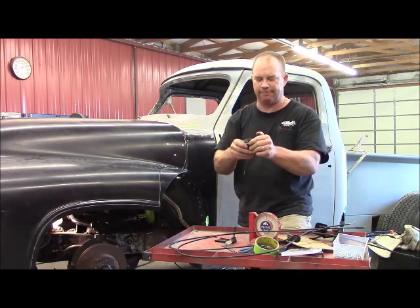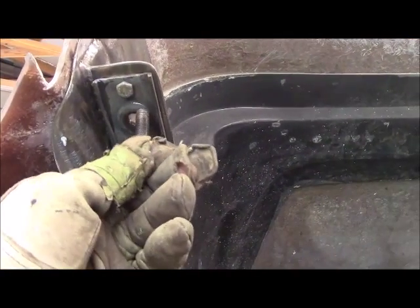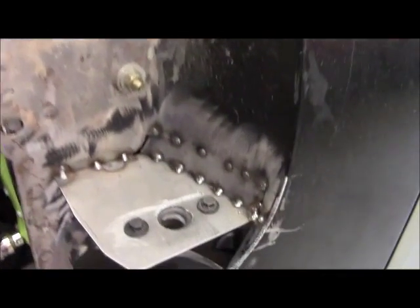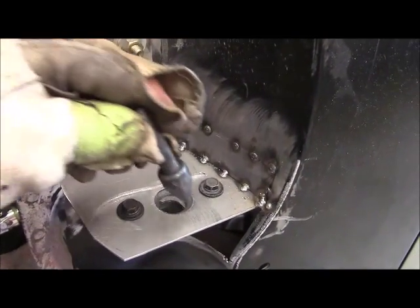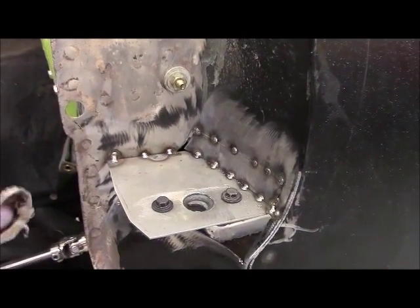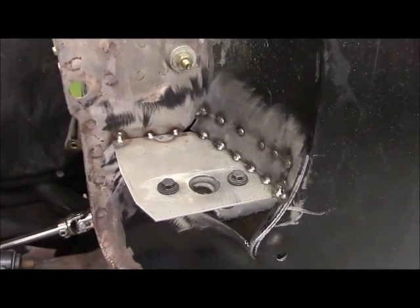Let me show you what this looks like inside. Up here on my hood, I've made a little piece of angle plate and a piece of 16-gauge that I've formed to the fiberglass hood. My pin will go in there and I'll have the spring on it like your regular hood latch. Down here on the firewall, I took the strike off the Chevrolet car and mounted it up in here where it'll move around and be adjustable. My pin will come right down and strike right into it like that. Then I'll button all that up, but first I'm going to go over to the other side and fabricate what I've got up there on the top and get it to this point.